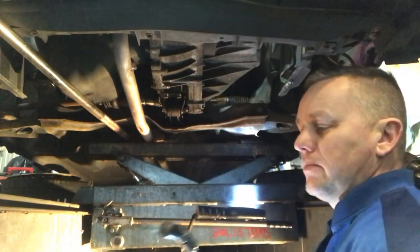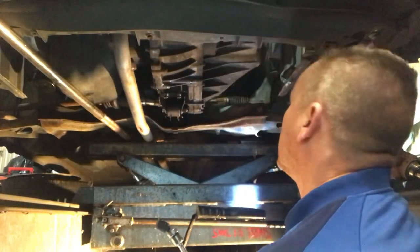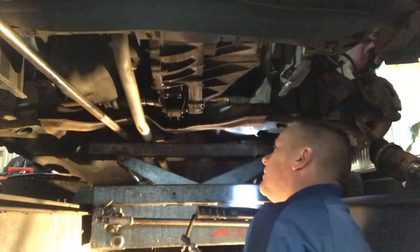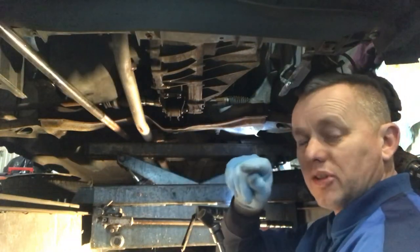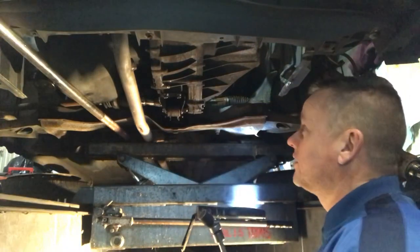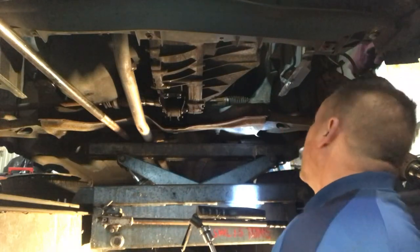All of these big 17mm bolts around the outside of the bell housing, these are the key to holding it all together. Right, so that's all the main ones out of there. Just got to take the plate off the back and the mounting off here, and then there's one 14mm bolt into the back of the starter motor. There's one into the starter motor from the top, and one from the back. There's only two bolts holding the starter onto the gearbox, which is great. We don't like many bolts. Less bolts to undo. Get this thing out of here.